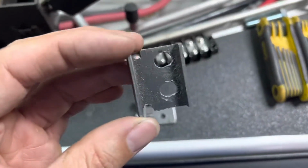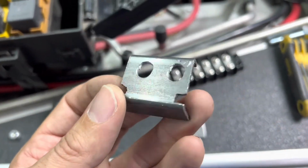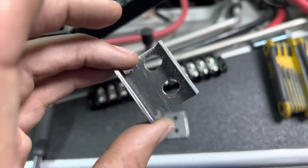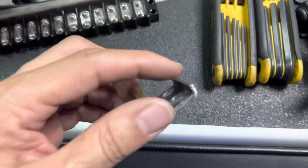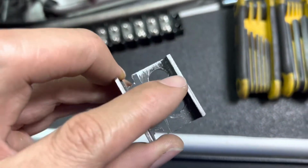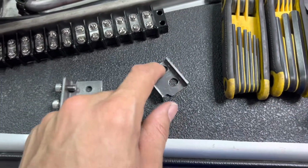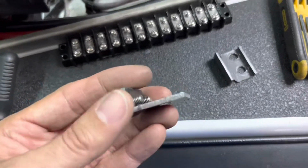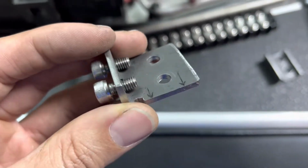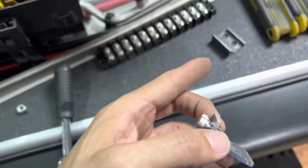I wasn't really that happy with this one. It was functional, but it's sloppy. I threw it together in a pinch just trying to make it work. And I decided I didn't like this lip after all because it was in the way of my socket when I was trying to get the two nuts on and off. So I made another one out of a thicker wall piece of 50 mil square tubing. That one was just 30 mil.